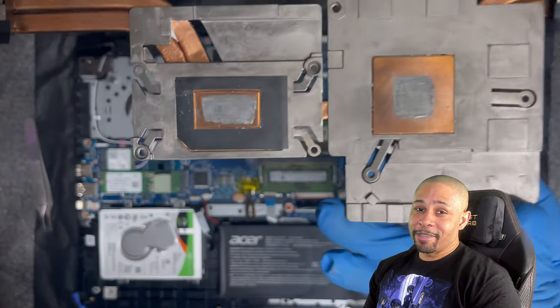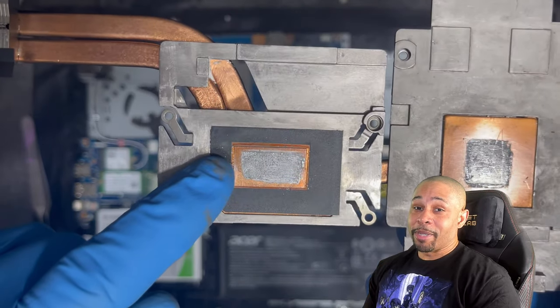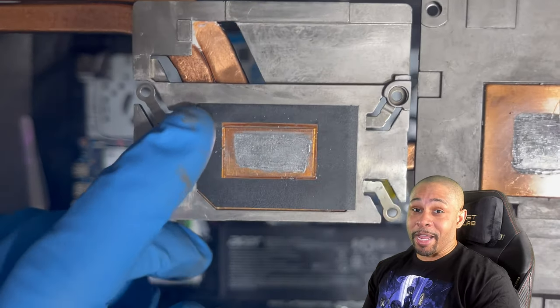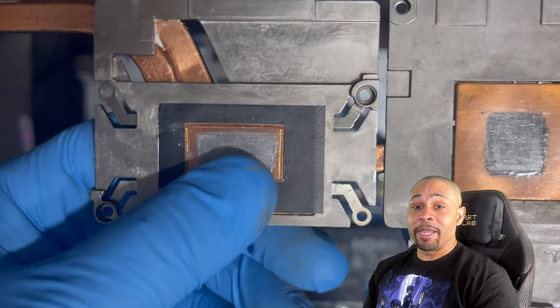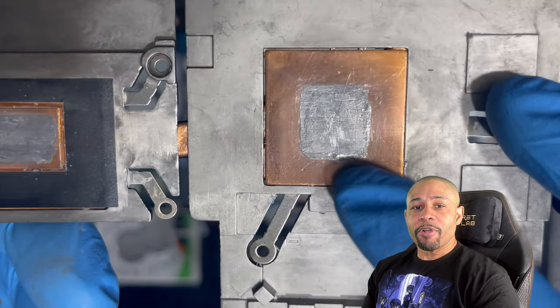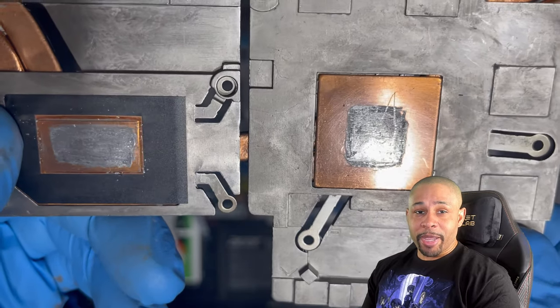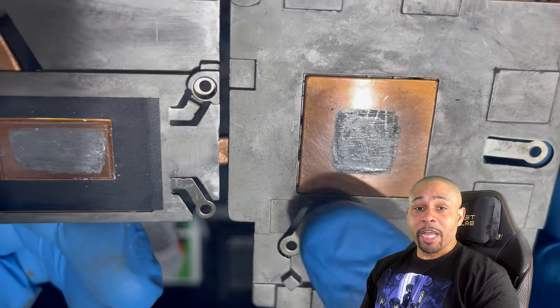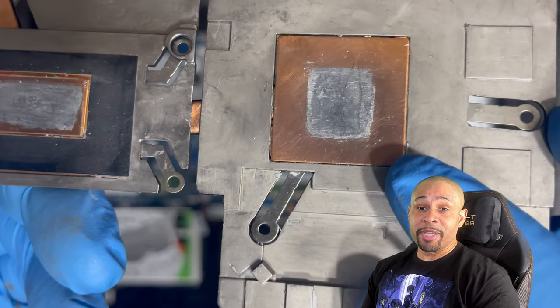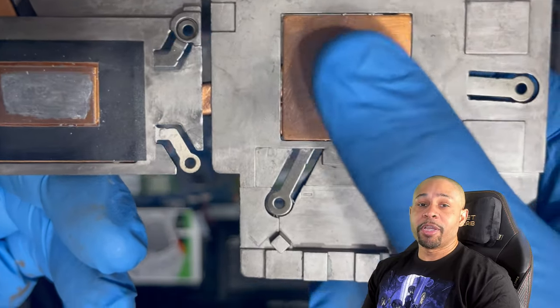Getting back to the heatsink, this cannot be taken off unless you scrub it, but you may cause even more damage. It's already pitting a little bit from the liquid metal test, so like I said before, if you scratch it, it's possible you'll make it worse. The claims you may have heard about gallium eating away at the copper, non-copper heatsinks is very, very true.